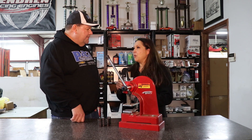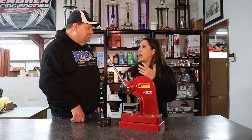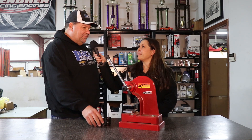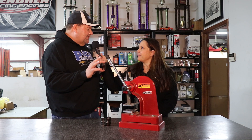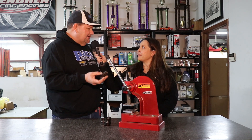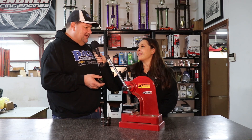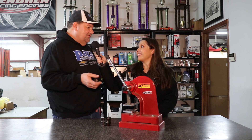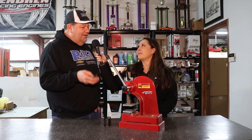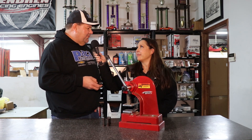Those are the critical areas I look at as an engine builder — those points on the valve spring and the camshaft. I don't sell valve springs by advertising a particular seat pressure number like 80 pounds. I don't rate them off seat pressure. You'll have springs that are only 76 or 77 pounds yet they meet the criteria at 1.400" and 1.270". These things are mass produced, and the consistencies vary — some batch numbers are really good, and then you'll have batch numbers that are horrible. You really need to get off of looking at the seat pressure number and look at that mid-lift number and the number at max lift where it's going over the nose of the camshaft. That's where you'll see your performance gain in valve springs.